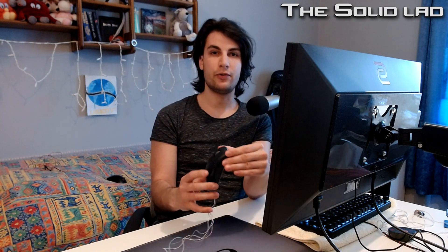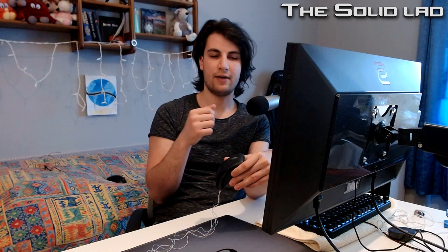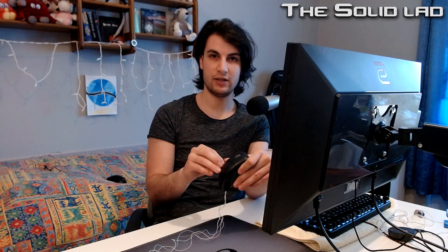Compared to cheap mice, their maximum tracking speed is relatively high. But other than that, they're pretty renowned for their sensors. Some people even prefer the sensor in these mice as compared to the newer ones. And the reason for that is because they have absolutely no smoothing, no filtering. It's just 400 DPI, no other options.